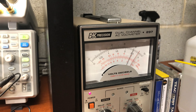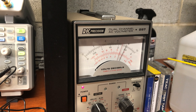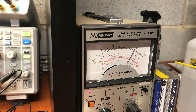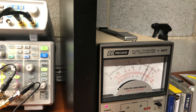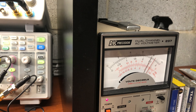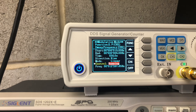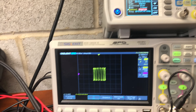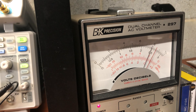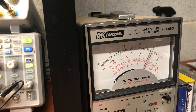15, 16 kilohertz, 17, 18, 19, 20 — wow! Type 1 tape, 120 microseconds, up to 20 kilohertz with no significant drop. It's amazing. The deck is still running and the frequency is staying within plus or minus one to two decibels all the way across. It's really crazy.